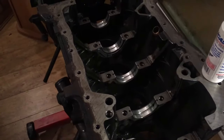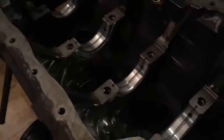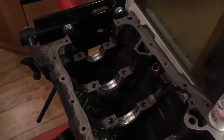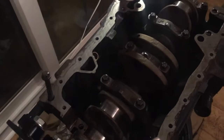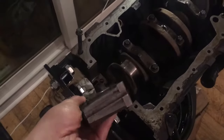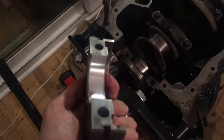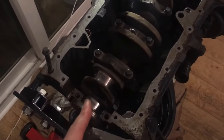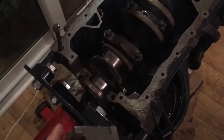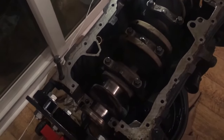Then the final degrees — I'll probably do 20 Newton meters all the way along, back off a little bit, then do it again. Thrust washers are in both sides. Put lube on and give it a good pinch — the suction will hold them. Four caps in, lubed, tapped down and finger tight. The end cap has a groove each side — run some silicon down that and put it in, making sure the bottom is clean. When dropping in the crank, drop it straight down — do not rotate it, do not spin the bearings.